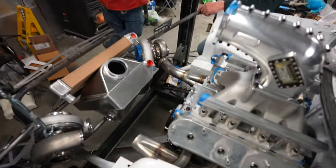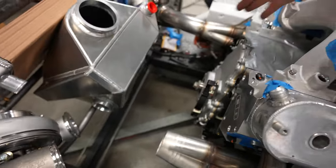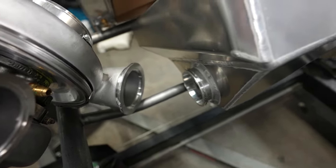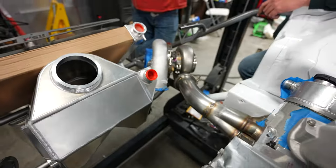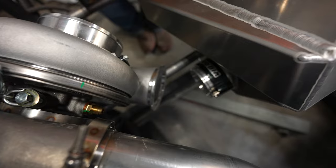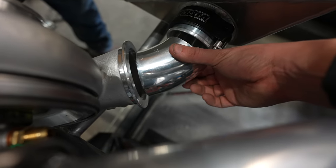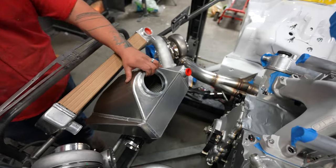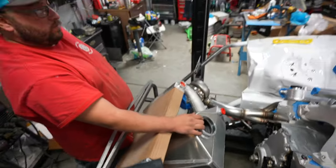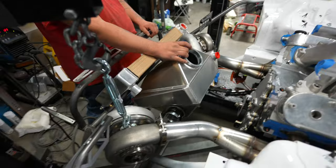After fighting that passenger side for a long time, we decided to put the driver's side on. We've got this turbo hanging here and this one is going to be quite a bit easier — it'll just come up and in, which makes life way easier for plumbing that side. Got back to work on it and got it tacked up — it looks like it's probably going to work out pretty easily. Using a piece just a little longer than the mock-up piece, this side should go together fairly easy. The harder side is the passenger side and I don't really want to fully build up this side until I know I can make that one work.